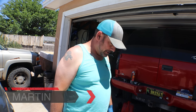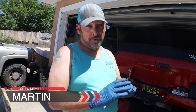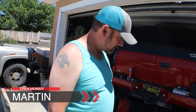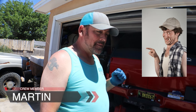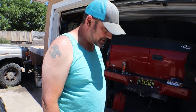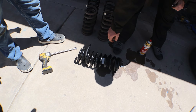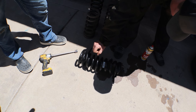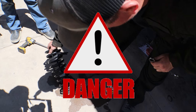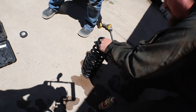Alright, Martin — tell them the dangers. So we tried the ratchet thing, the redneck way. That didn't work at all. We're talking about compressing the spring, because it won't fit in the pocket if it's not compressed — the pocket between the A-arm and the upper mount. You have to compress the spring. The problem is it's very dangerous, unfortunately. That's why we're being very gentle with this. We rented a spring compressor.